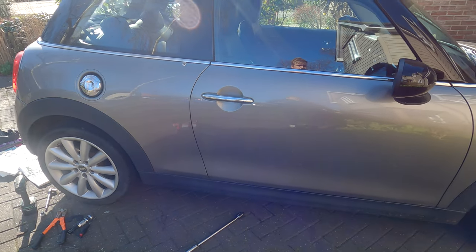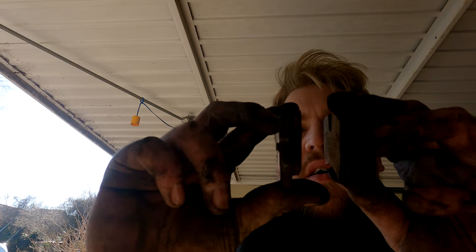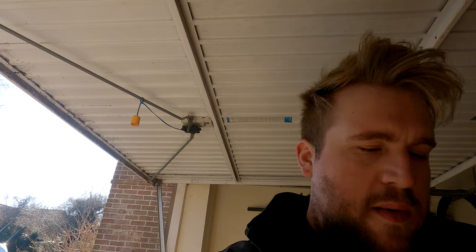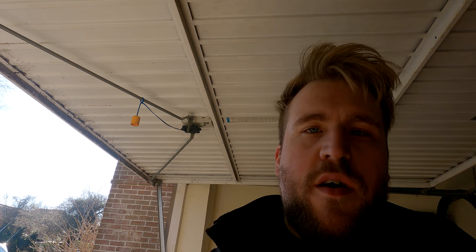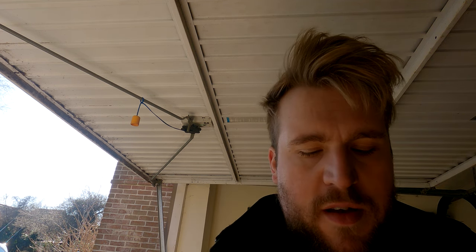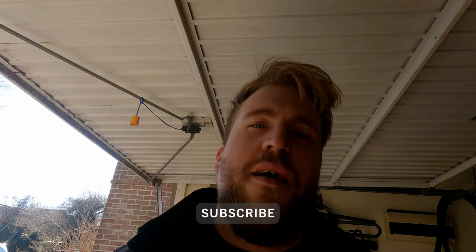Take it easy for a couple of hundred miles. Apart from that, just do the brake service reset. As you can see, the pads are getting low — especially on the inside — but not anything crazy, so it's a job well worth doing. As long as you've got Carly or something to reset the service light, for £22 versus £200 at the dealership, it's worth doing. Just follow my guide and you'll be absolutely fine. Next video I'll show you how to reset the service light and change the brake pad sensor. If you like what you see, give us a comment, a thumbs up, a like and a subscribe. I'll catch you in the next one — see you later.